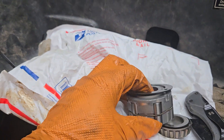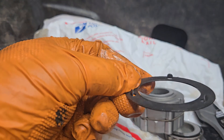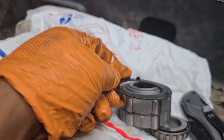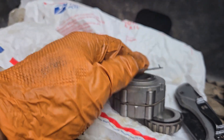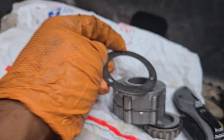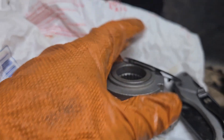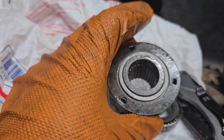It has this cam here — it's the 4x4 cam — and you notice it has this plate. It has three ears on it. You want to make sure these three little protrusions — one, two, three — are intact and not flattened down. I see those flattened down sometimes. Those protrusions correspond with those low spots on the cam.